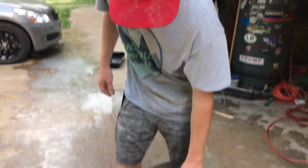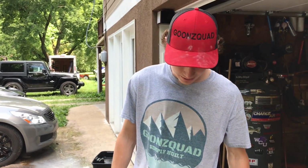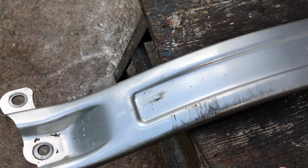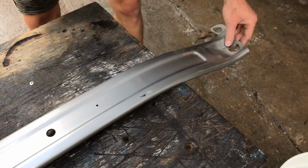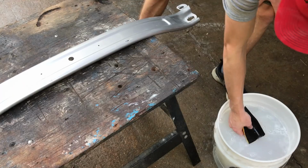So we took that emblem off, took all that little glue and stuff off of there. I'm gonna sand it with the 600, wet sand it all, and see how some of this comes out. It looks like all surface scratches, so hopefully we get all this off and have it nice and smooth, ready for some paint. Hopefully we can paint all this today.